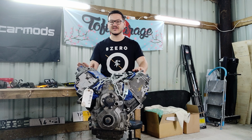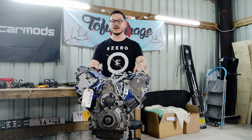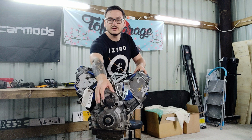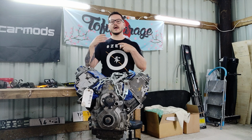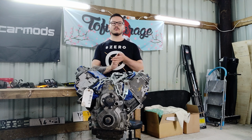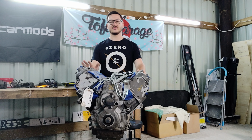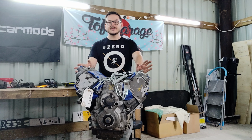And so, I need to get rid of the VVT and put in a normal car LS3 cam. It's as simple as taking off the front timing cover, changing a few components, the timing cover itself, the cam, and putting in just normal car-based components. Very simple. When I get close to the time, I'll start going through exactly what I'm going to be replacing and with what. Not so much as a guide, but these are probably one of the best bang for buck LS engines you can get. Like I said, they're cheaper than the LS3, but simply more powerful than the LS1, 2 and 6. And so that's the main differences.